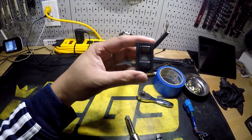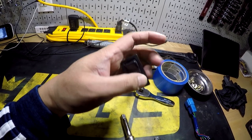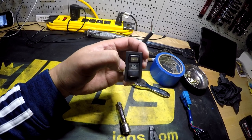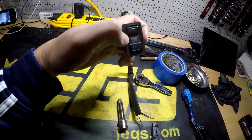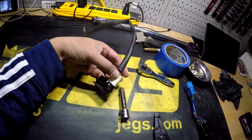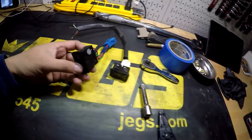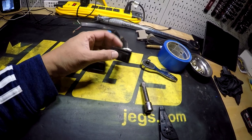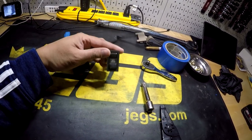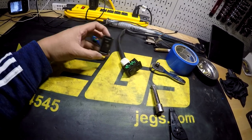Here's the third-gen switch from a 96 through 98 Toyota 4Runner. You can see the down and the up are kind of backwards — the bottom one is up and the top one is down, which is not ideal. It works in the front of the 4Runner, but in the back it'd just be confusing, and if you try to flip it, all the words would be upside down. Also notice there's no harness, just a plug. This would work since you'd wire the three wires up the same way, but the second-gen has a nice harness for you. Either one will work — if you prefer cleaner with correct orientation, go with the second gen; if you don't care, find a third gen. I actually have two switches since I got this one first before I found the second gen.